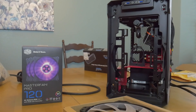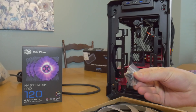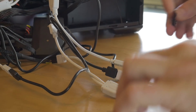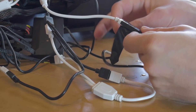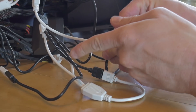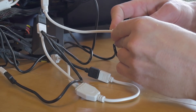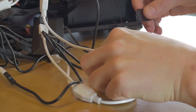I wanted to go ahead and get the other two to match with the Cooler Masters. It does have a controller, but we didn't have enough to hook up the controller to everything, as it only has four ports. So we had to get some splitters to go ahead and split it out. We were able to run two RGB LED strips, the three fans — so that's going to be five right there — the pump, and the two RGB LEDs that go into the CPU block.